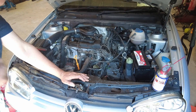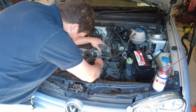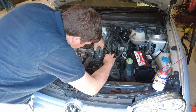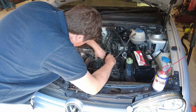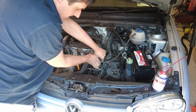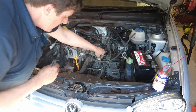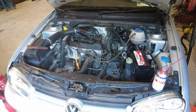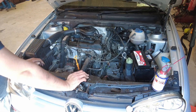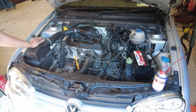It's a bit cleaner. As I said, I have a new one ordered anyway, but let's just try it out and see. Should have cured our misfire — it has to have been that. That's the distributor cap back on, new plugs in, oil in it, new air filter. Let's start it up and see how it's running now. It should be a hell of a lot better anyway.